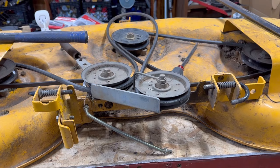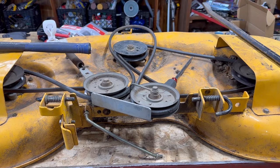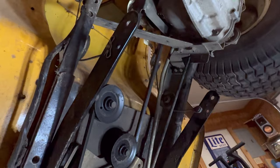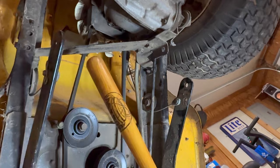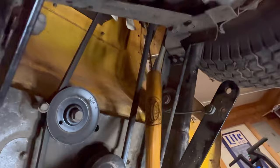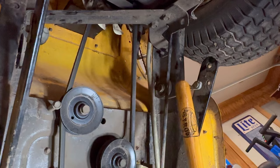So we've got our pins straightened out. Next, I'm going to slip underneath the lawnmower and show you what these pins actually hook to so you can understand the whole goofy Cub Cadet cable leveling system. So now we are actually inverted — I'm laying underneath the Cub Cadet lawnmower deck hoping it does not fall on my face. What you have is these two bars right here, and those two pins we just showed slide through there. These things are held up by a 16-inch wire cable — it slides up there, it's got a roller, and then it slides up to the actual lifter mechanism where they're tied together. So that's another thing to check: these cables — make sure they're not ripped. They're only about 10 bucks; I'll put a link down below. Just another thing to check.